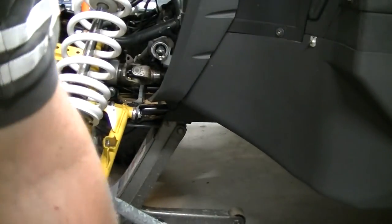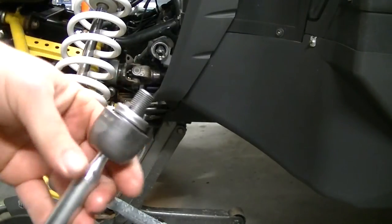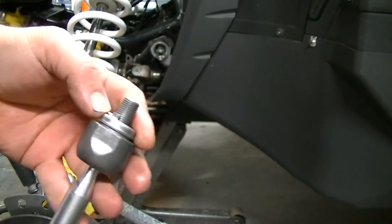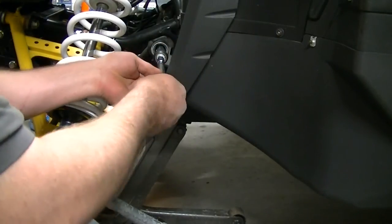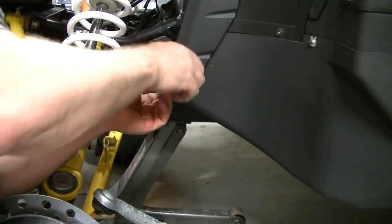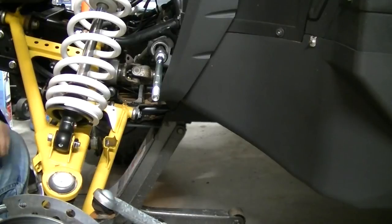When you buy the tie rod it comes with the new retaining rings included. Put the new tie rod back in. This is the retaining ring they have — the tabs go into the actual steering rack. That lined up nicely. This is going to torque down to 40 foot-pounds.